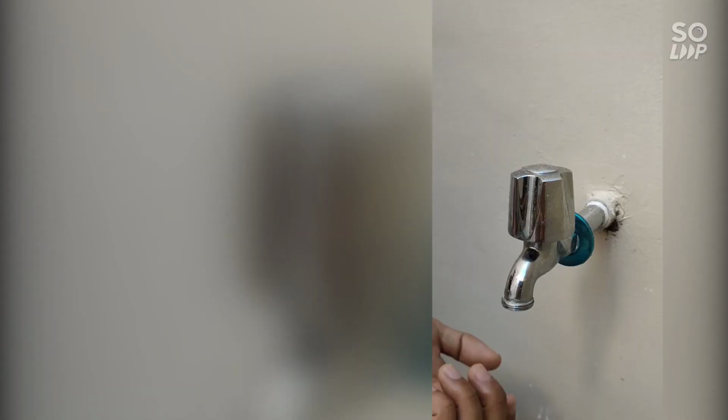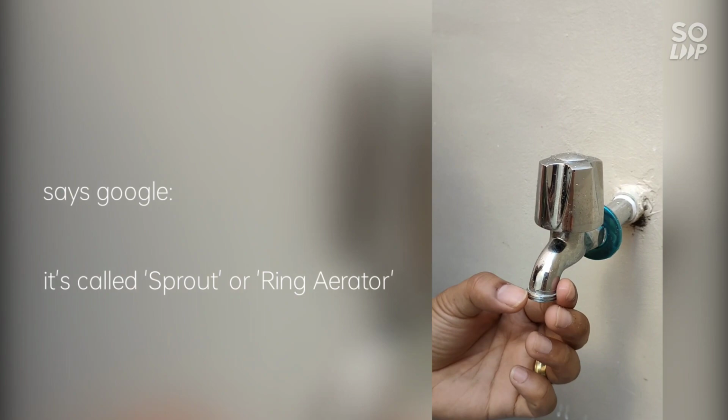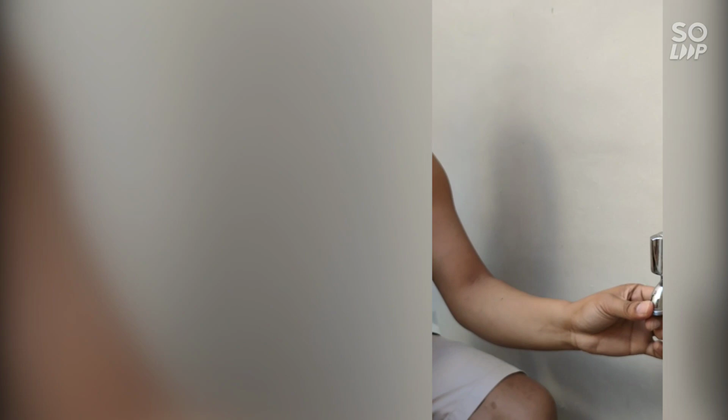And so one tip that I learned from this is, before you go to Wilcon or to any hardware, you need to see if the head or the edge of the faucet has this. What do you call this one? Please comment down below. What do you call this? Because without this grip or something, you will not be able to connect it to the hose. Special faucet. Yeah, because some of the subdivisions or the houses, their faucet do not have a grip like this, so it will not connect. It's very important. And so we are going to connect it now.